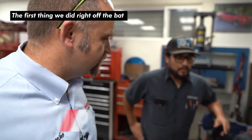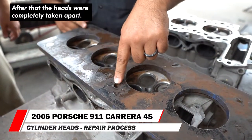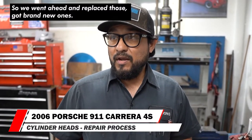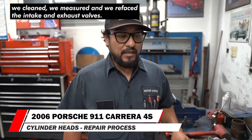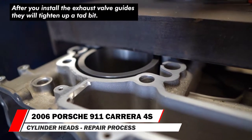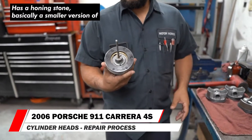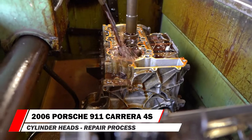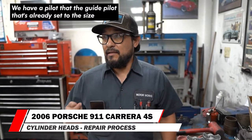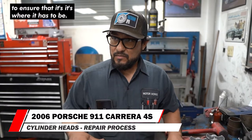To summarize what Cisco did: first, pressure tested the cylinder heads to make sure there's no cracks. Then the heads were completely taken apart. They inspected everything and found the exhaust valve guides to be worn out, so they replaced those with brand new ones. They decarbonized the cylinder head completely, cleaned and measured and refaced the intake and exhaust valves — everything was within specs. After installing the exhaust valve guides, they tighten up a bit, so they use a honing tool with a honing stone to give it the proper clearance using a guide pilot already set to the correct size.